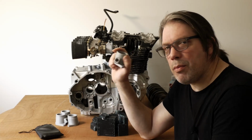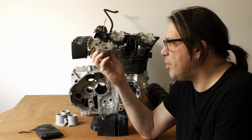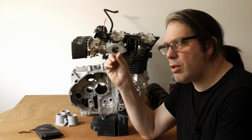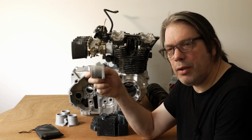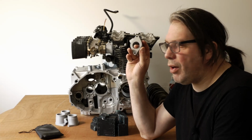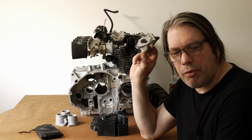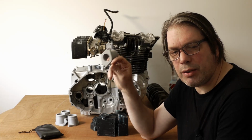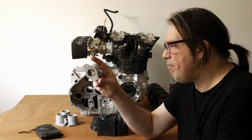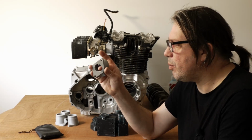I've also seen some 3D printed ones in use on cars where they're printed directly in things like carbon-filled nylon. I did buy a little sample of a carbon-filled nylon filament, and I had a go at printing some test pieces. I did find it quite difficult to print. It's extremely hygroscopic. It's very difficult to get a nice finish on it. I think it might be possible, but to be fair, with my printer, I think it's probably going to be more effort than it's worth, really.